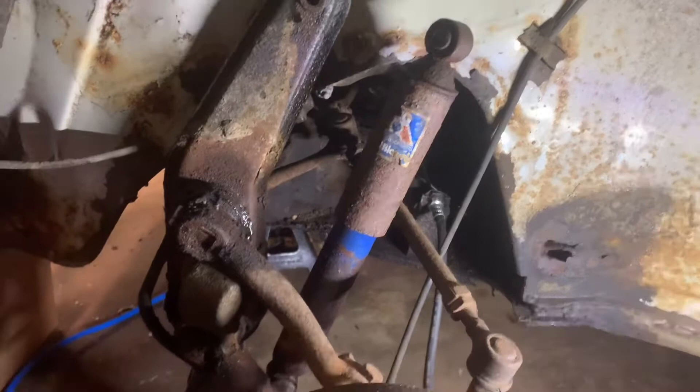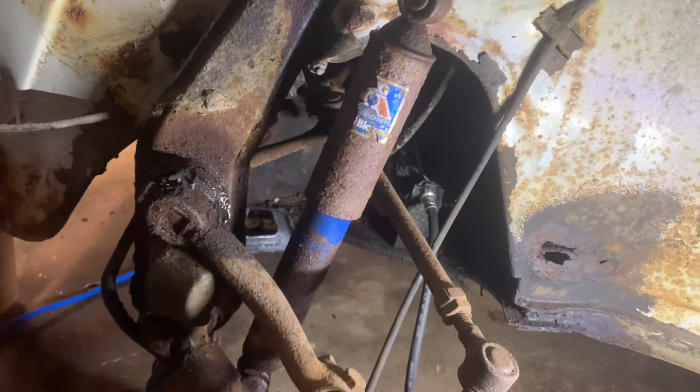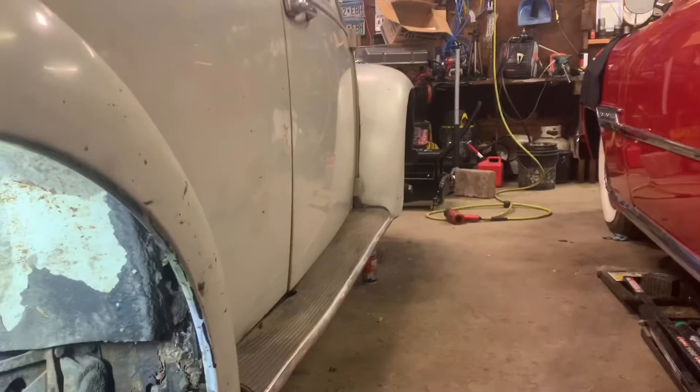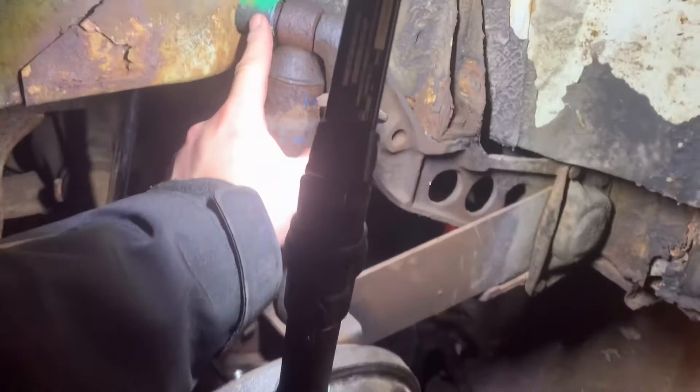Well, I'm not sure why I said it was going to be easy. This guy does not want to come off the mounting stud down there. And the one on the passenger side, I can't get the top bolt out, and the bottom also doesn't want to come off. I hit the front with some PB Blaster and we're going to let that sit for a while and work on the back. We've got a 19mm nut in here with a 17mm head on this bolt. I'm assuming the bottom is the same. Hopefully this comes off.